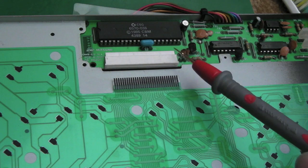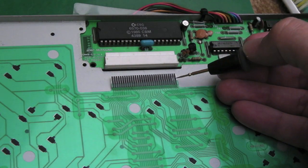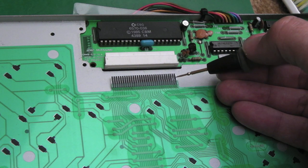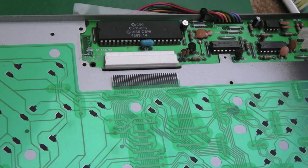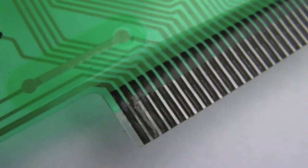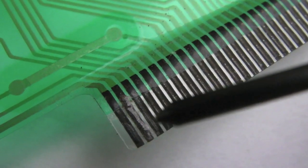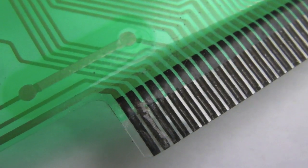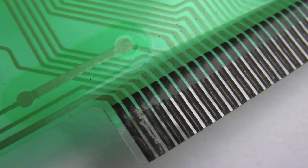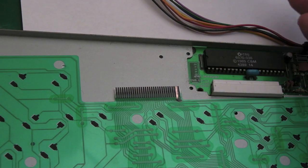It's mysterious because it's occurred inside that connector there, which would never be subject to any movements or whatever. It's a bit bizarre really. I can probably fix that - I've got some conductive silver or nickel paint and I'll just cover that a little bit there. I'll mask off the side pieces first, then just cover that little bit of trace, let it dry, and give it a try. There you go - that second trace I've just covered with a bit of conductive paint. It looks a bit uneven, and some of it's going to get worn off as it gets pushed in, but hopefully it might still remain joined.